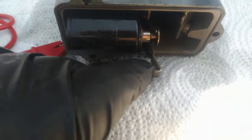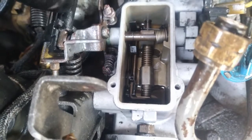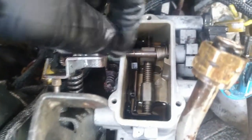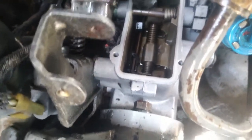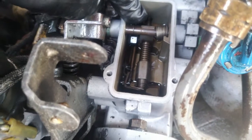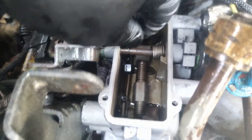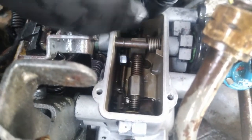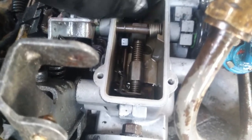This tab right here will go into a slot that is up here in the fuel pump. It would actually go right here on the backside of this little ramp, and when it is energized the button goes backwards, which would allow this thing to go forward and backwards. If it shuts with the power off, it automatically goes forward which will shut the fuel off and close the metering valve. So with it energized it moves out of the way and fuel is able to travel at that point. Like I said, it was stuck before and now it's free, so I think we'll be alright.